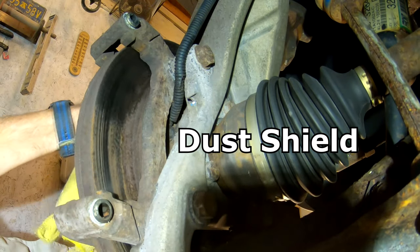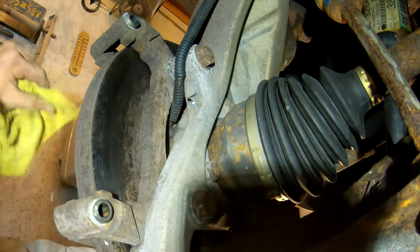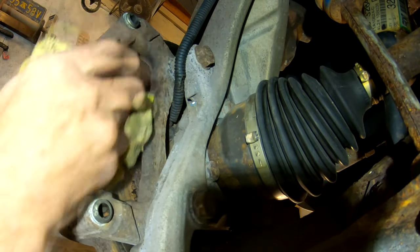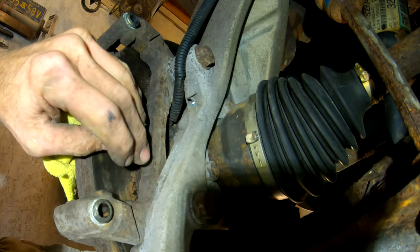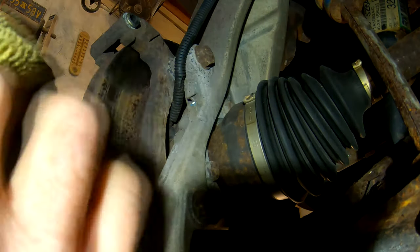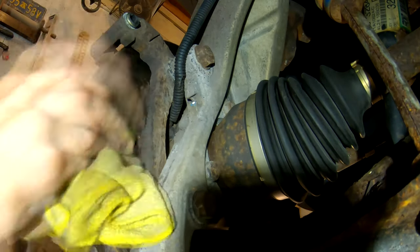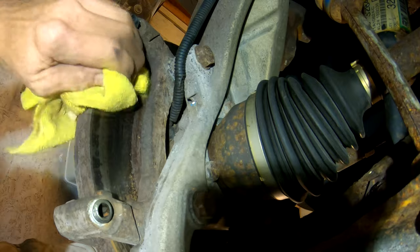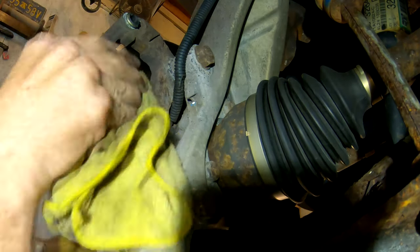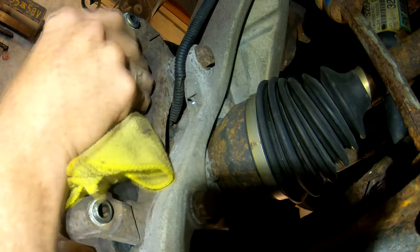There's her drying rag — just keep repeating, turning it a little bit at a time. The option is to pull that bracket off, but those bolts are often pretty tight and since I wasn't putting a new rotor on I did not really feel like messing with it. It is astonishing how this wax and grease cleaner and rag is just wiping this rust off with no problem at all. The vehicle was driven the day before and just sat in the garage overnight. Gotta love a humid climate — it's summer here, probably about 80 to 85% humidity will do it every time.